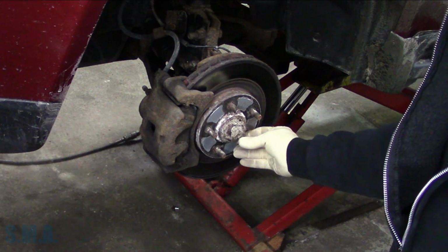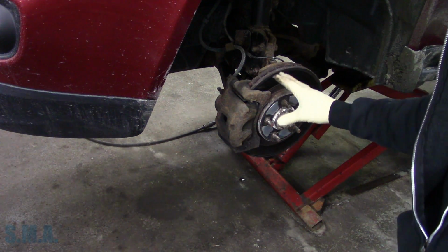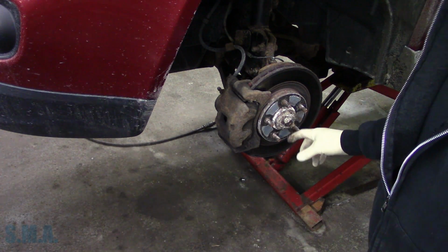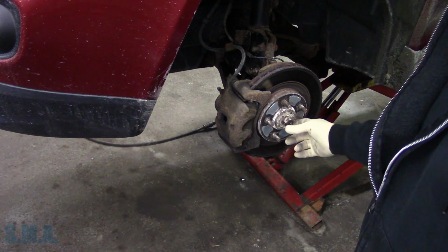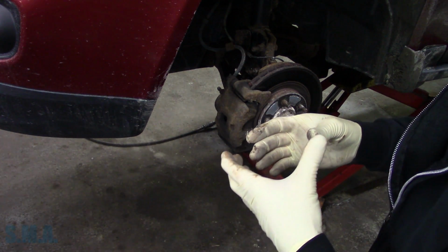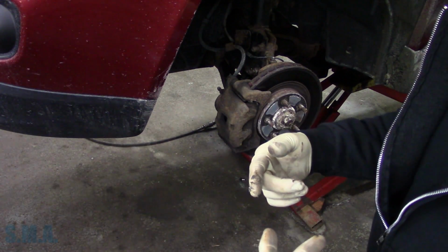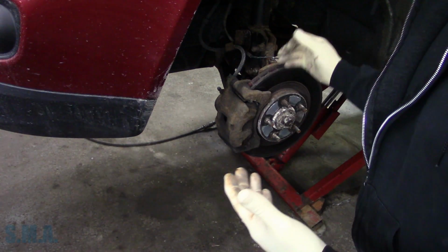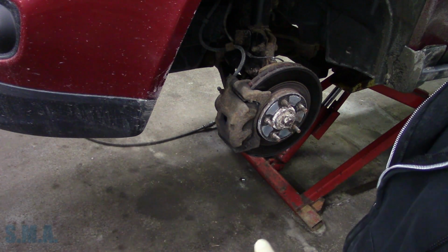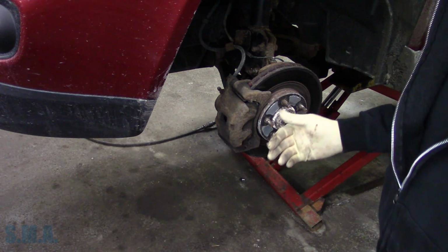My thought is these active wheel speed sensors, they work off the front wheel bearing. Now this is the press-in bearing on this vehicle. And what usually happens is the magnetic ring that's on the back of the bearing itself falls off or breaks and creates an erratic signal. And frankly, these connectors, because they go all the way up around into the body, and this one's way back under the cowl, and the other one you can't even see it. They're kind of a pain to get to.